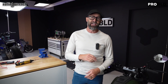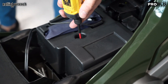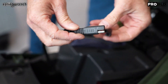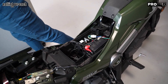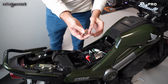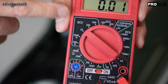Now let me show you how to test a battery and do a load test — this is one of the most common things that go bad. It's a $15 part and it's really easy. So let's pop the seat on this sucker and get to the battery — it's going to be different on every bike. On the multimeter, we want to go to DC volts, 20, or the lowest number above 12 volts — in this situation it's 20. We have these little alligator clips, which are nice for diagnosing issues — not a must, it just makes it hands-free.